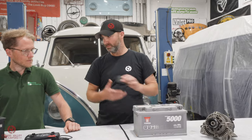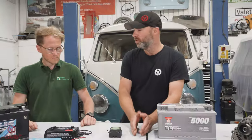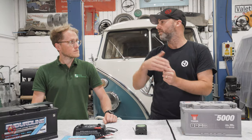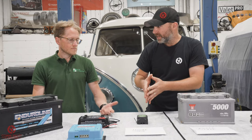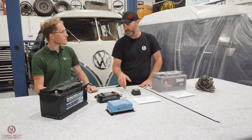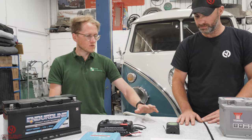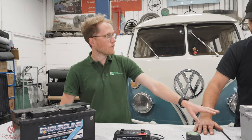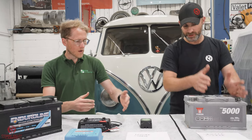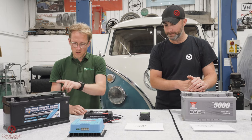In the past we've spoken about the VSR — voltage sensitive relay. There's an even more basic version, a 30 amp relay that switches open and closed via a 12 volt signal. Most camper vans today have a VSR, which senses when the battery is at approximately 13.7 volts — a voltage only achievable when the alternator is outputting a charge. That simply joins the two batteries together, letting whatever comes out of the alternator go straight through into the leisure battery with no voltage adjustment or regulation.